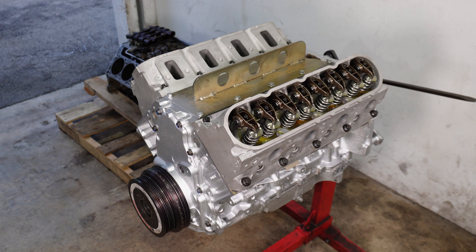The trunnion kit also came with a fresh set of bolts for the rockers, which is nice. I went changing all the bolts underneath on the rods and stuff like that and measuring the length of all my main bolts because the motor had a bunch of miles on it. It was really nice that the trunnions came with fresh rocker arm bolts. There's a lot of new hardware inside of this motor to go along with all the new cam bearings, the new rods and mains — with the exception of the pistons, cylinder walls, and rings, this is pretty much a fresh remanufactured engine.